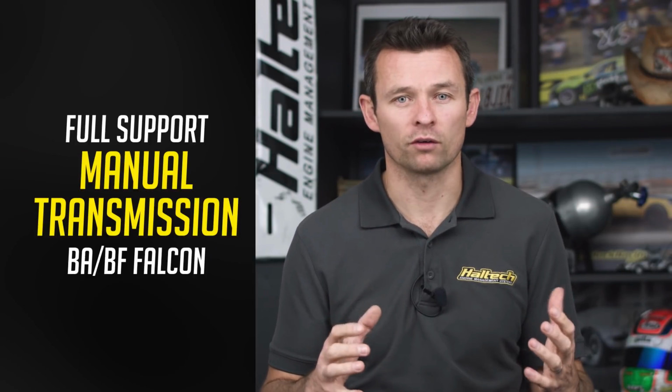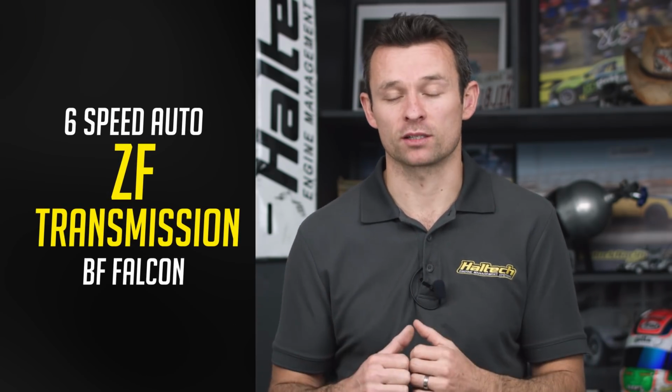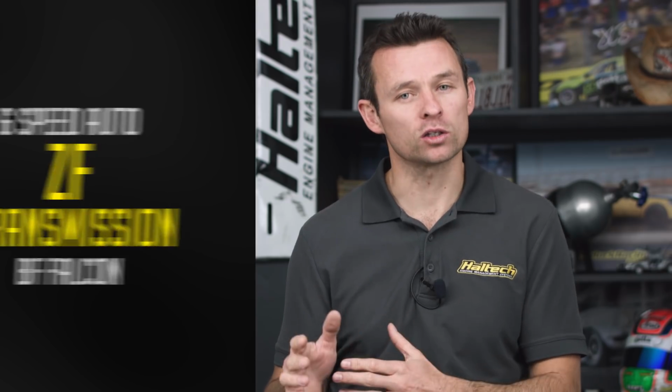Now I know you're also wondering about transmission control. Well, the initial release of this ECU will have full support for manual transmissions in BA and BF, or 6-speed automatic ZF transmissions in the BF. This will be closely followed by full support of the 6-speed ZF automatic transmission in the FG.